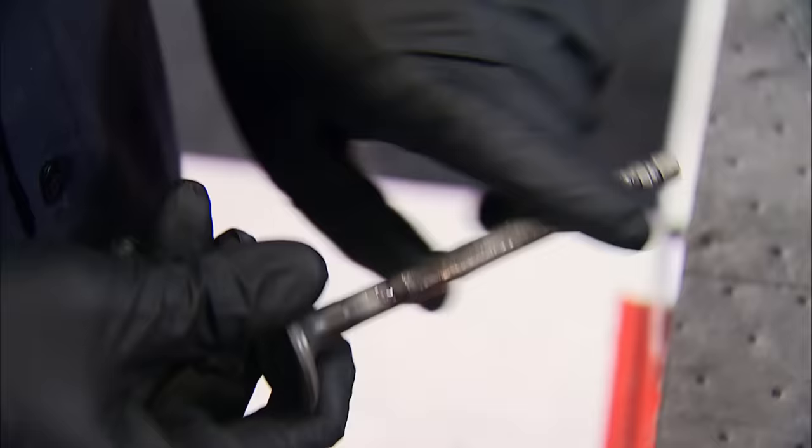For you guys that like a shorter engine with a couple of extra cylinders, here's how to install a Canton crank wiper on a small-block Ford 302 — a cheap way to free up some extra ponies. At highway speeds, your crankshaft's rotation causes a horizontal vortex of swirling air inside the crankcase. As oil drains back down from the top of the engine to the sump, it gets caught in that vortex — kind of like swinging your arm through a swimming pool, creating a lot of drag and losing horsepower. Tests have shown one to three quarts of oil can get caught in that vortex, leading to oil starvation at the sump at higher RPMs. The wiper sits between the pan rail and the oil pan and its job is to wipe oil from around the big end of the rod and the counterweight, disrupting the vortex and getting oil down into the pan faster.